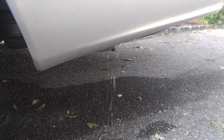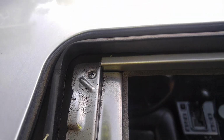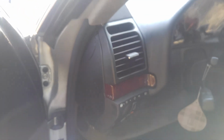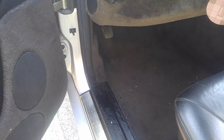Here is our drain coming down from the rear of the vehicle. That's great, so the rears are okay. And then we do the front. Okay, so for the front, we're not going to overfill it, we're just going to get just a little water up to the front. So here's the pipe, just a little bit, you don't need too much. That's a little water up front. And what do we have? Like I said, it channels down the pillar, because it leaks right here, gets into the channel and drains right out in the corner. That was just a little bit of water.